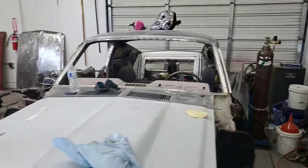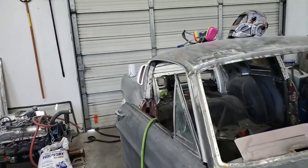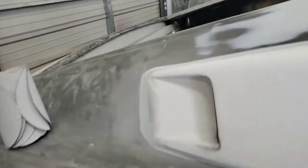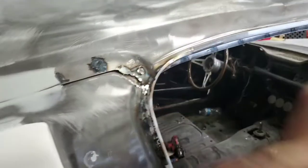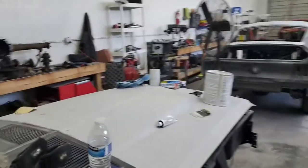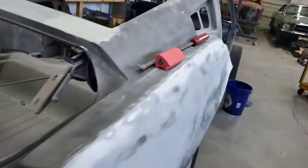Update on Sway — she's getting some body work done. We're just blending: we've done all the blending on the side scoops, the wheel wells, upper scoops, and the rockers down here. Everything's coming right along. Next step is priming — we just need to finish filling in a little gap up here and then the A-pillars at the front, and we'll be pretty close to priming.